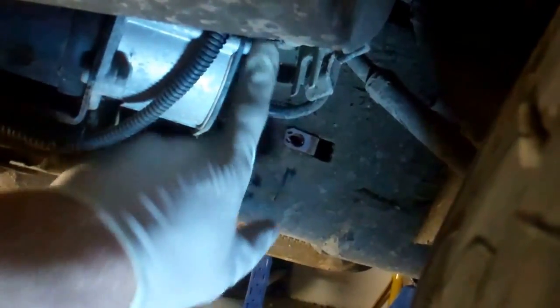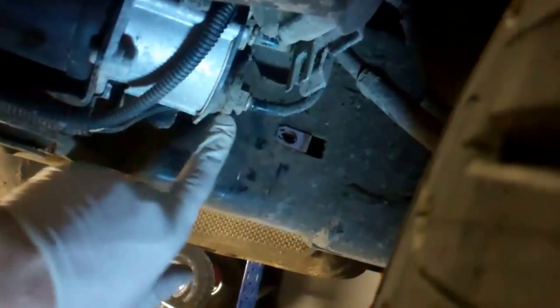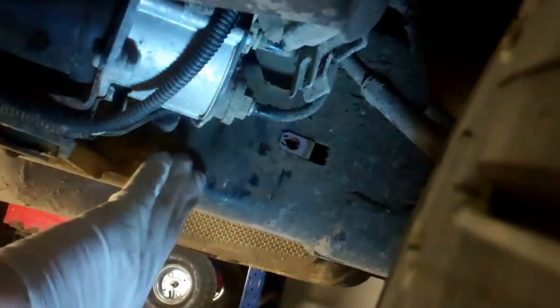So we're now at the rear of the compressor, and there's two bigger diameter pipes that go into these brass fittings, not these plastic ones. And we haven't done a load of WD-40, we haven't done a load of stuff, but basically I've tried pushing them in and pulling them and giving the little thing, and I can't get them out. And reading the internet, that seems to be the problem. So we're going to cut the pipe. Now, we don't think there's any pressure in these. I can squidge them. We haven't drained the system, so we're going to see what happens here.